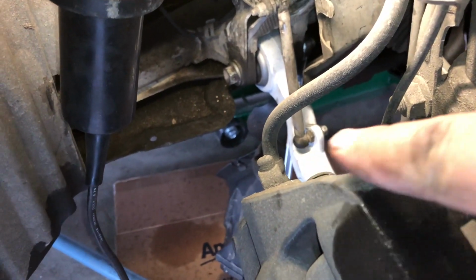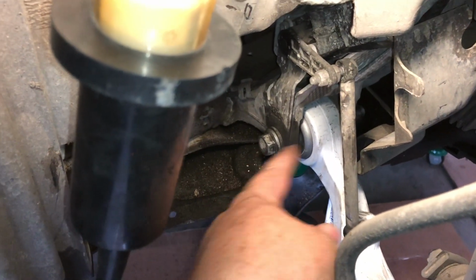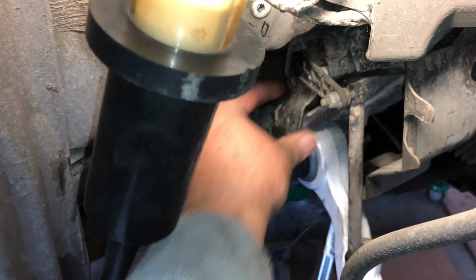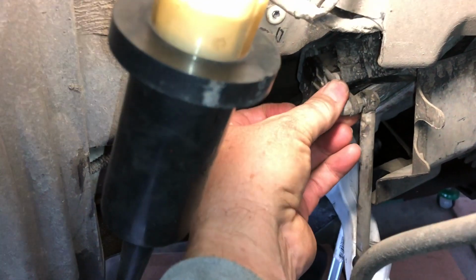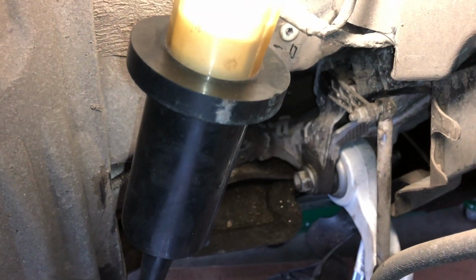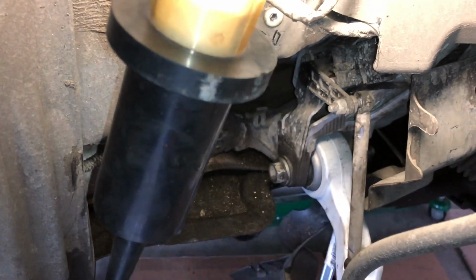You see it there. I've reattached it back on. Where it goes to at the top, it's actually actuating an electronic switch. And this side, when you bolt the big fat end here through the bush through, there's actually this clamp on the outside comes down, this bracket, and that's mounting this electronic switch. So what's actually going on here is that when the suspension's going up, it's sending a signal through electronically, so the car knows. So it's part of the suspension setup.